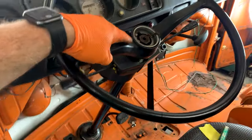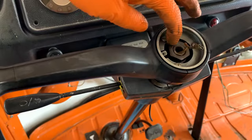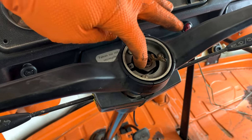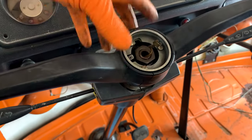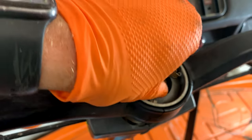Here's the lay of the land. We've got our steering wheel still on there. I've loosened this nut and I'm going to show you guys how to break the steering wheel loose from the actual column shaft itself. It's a little trick I came up with to make this a lot easier and not break your steering wheel, without having to use a big puller on it. Once you have loosened this nut — I think it's 27 mil if I remember correctly.